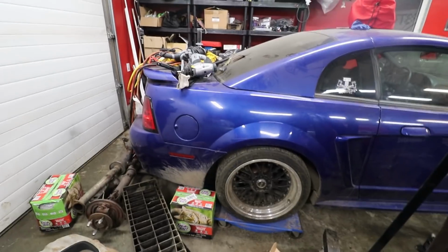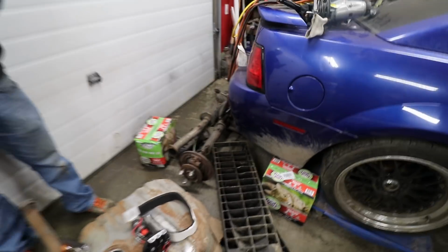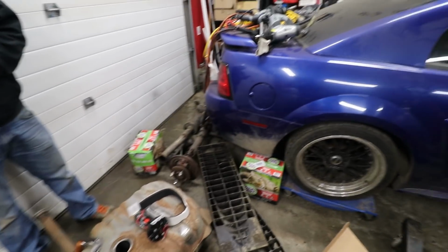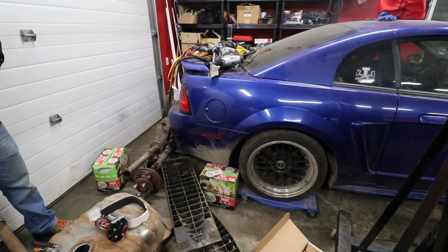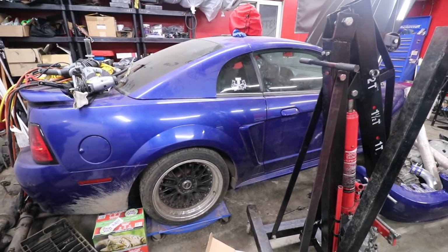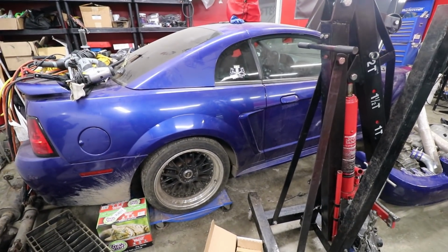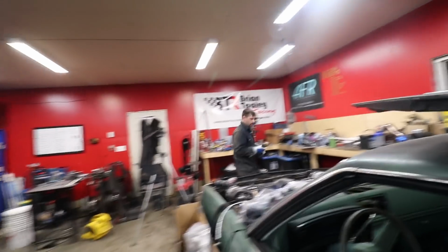Okay, here's one for all you YouTubes. So under the Malibu there will be a Fox Body 8.8. It's currently 4 bolt. There is axles on order. Strange 35 spline, 5 bolt with C-clip eliminators. Has anyone ever put stock New Edge Mustang or 94 to 98 Mustang disc brakes on the rear of a Fox body? If you have, or if there's an adapter for it, let us know, because I'm going to Google it in the meantime. But the YouTube sometimes knows better than the Google.